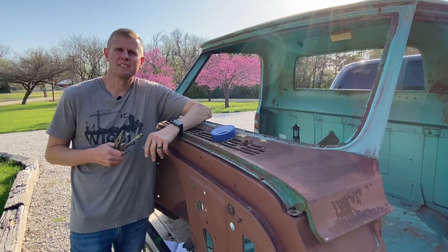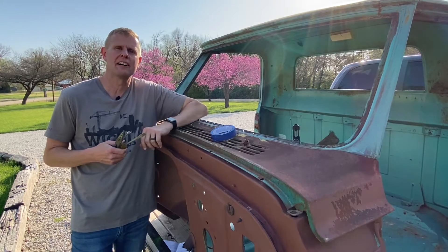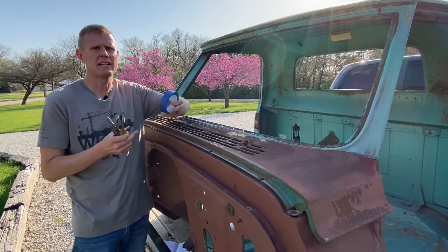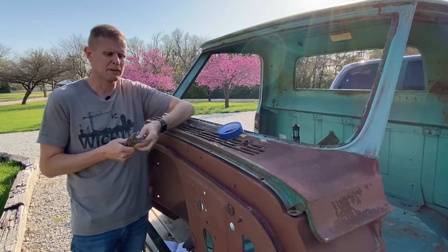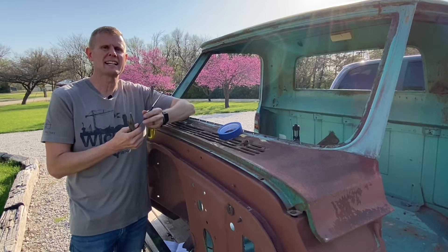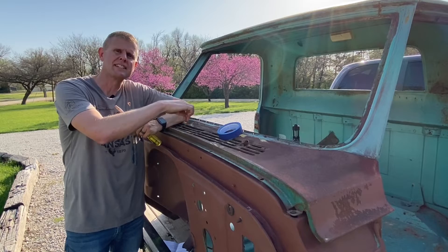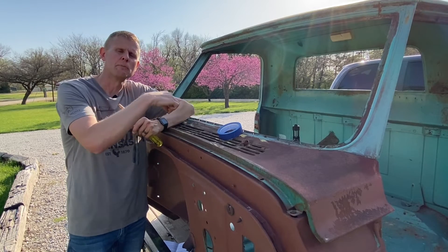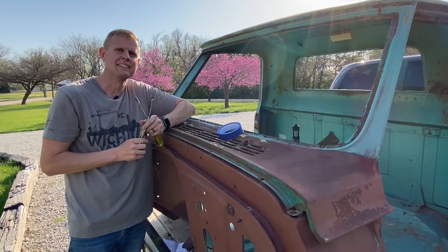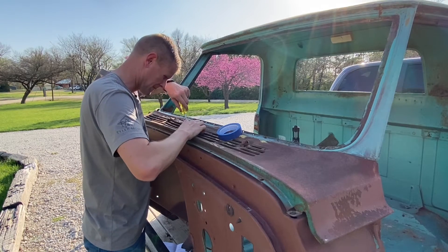Option number two: it sucks, but we're going to try to get this wiper motor out without taking the outer cowl off — that is going to be a challenge. If you have a nice paint job, first get some painter's tape or masking tape and tape off some of these cowl openings. You're going to need a flat blade screwdriver — it needs to be magnetized — or a small magnet and some type of long needle nose pliers. What we're going to try to do is go through these cowl openings, pry off the clip, and then remove the transmission arms so we can detach it from the rotating arm of the motor. If you hold your tongue just right, it seems to go a little bit better.